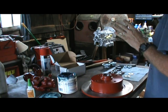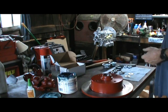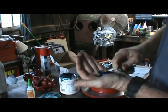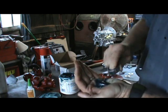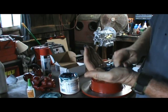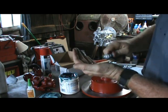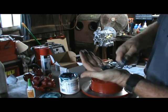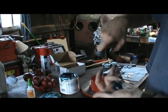What I want to do now is go ahead and get the bearings greased. I'm going to go through the steps of how to load up a wheel bearing — most of you know, some of you don't. I get a palmful of wheel bearing grease, put my finger in there, and just keep working it. You'll eventually see the grease start to peek out. I just keep packing until I have it peeking all the way out of the top of that bearing, then turn it and do some more. Bigger garages will have a wheel bearing packer, and if you do a lot of brake work I'd invest in one, but I can't justify that expense myself. When grease is peeking out all the way around, you're done.